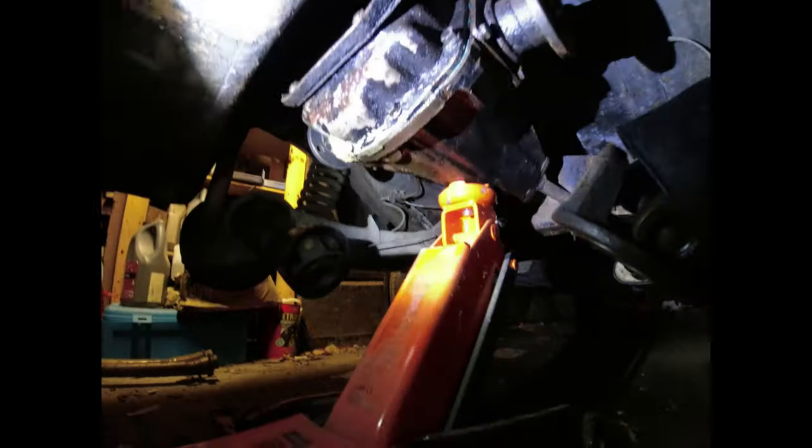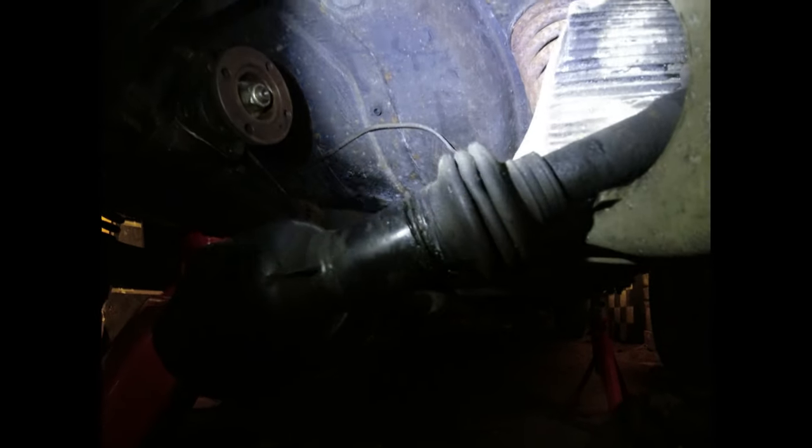You can't do this with the wheels on the floor, because the rear end of the diff is actually part of the rear suspension geometry. With the diff out of the way, the subframe just drops down too far. There's a lot of surface rust under it, though, I've been noticing. I think once this is back up and running, things can get a proper good clean off and treatment under here. That seam seal peeling away over there. Oh dear, oh dear.